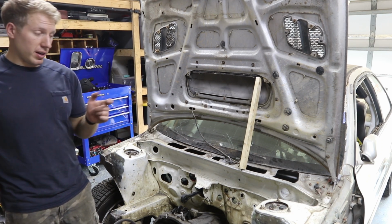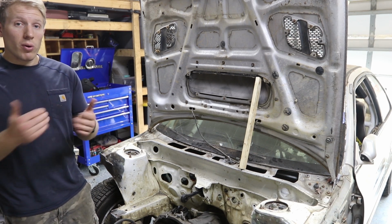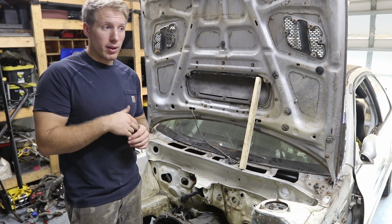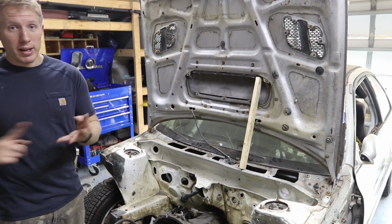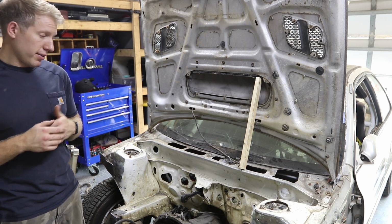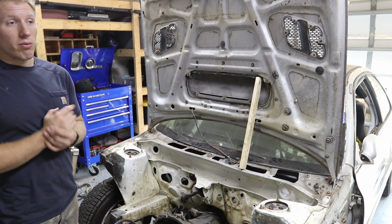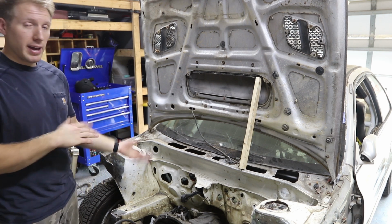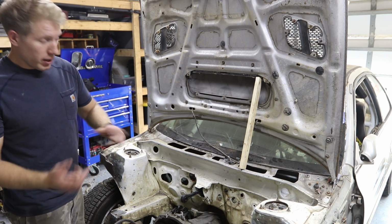Brake master cylinder, we got to leave that one too. And then there's one little one down there that we got to patch up. So all the things that used to pass through the firewall, which is a grommet, like my fuel lines did, my brake line did, and so did my hot and ground coming from the battery. Those all passed through grommets, and some of those grommets that I made deteriorated and caused a lot of rubbing. Luckily, I didn't have any issues with shorting out the hot or anything like that, but it has the potential if that ever became more of an issue. So we're not going to be doing that anymore.